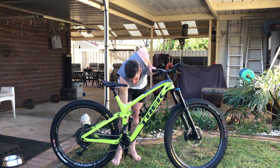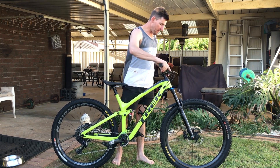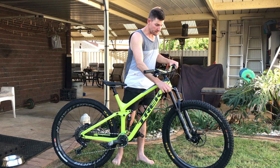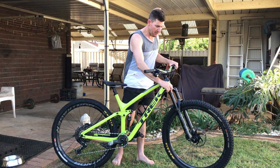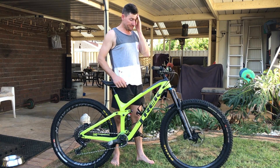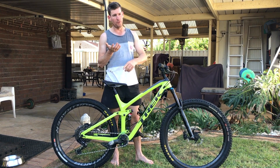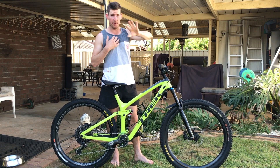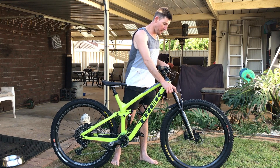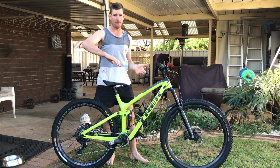Once in the low setting I fine-tuned the suspension. With the Grip 3 damper there are subtle changes between completely open and halfway to the middle position, but you'll only really notice that difference once you've got your spring rate dialed in. I rode Twisted Gum, Ewok, Bullet Track, Four Course Meal up at Waterfall Gully, and Working for the Dole — a fast, flowy singletrack. This thing carries wicked speed on fast flowy stuff. Being a 130mm travel bike you're not going to lose yourself in the travel, and it's really good to flick around and throw.